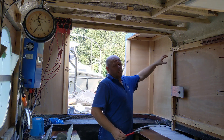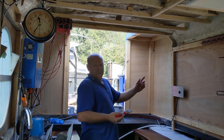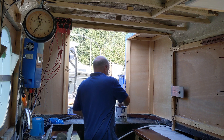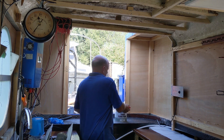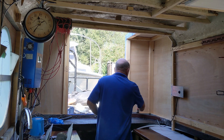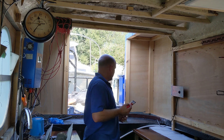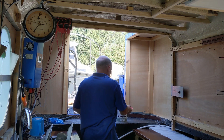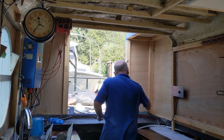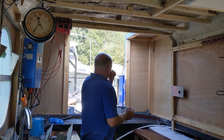For the outside I've put a coat of that blue paint on there - while that's drying so I can get a second coat on, I'm going to start putting some of this floor paint on this section in here. I'm using floor paint because it's really good, hard-wearing, and very waterproof. Obviously by the time we've done with this we're never going to be able to get to it again because we're putting insulation and boarding it all out, so I want to make sure this is really well protected. Give it a good coat, slap it right in there into the corners.